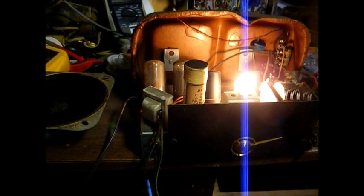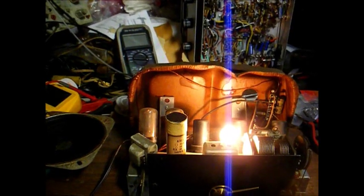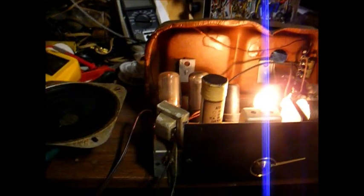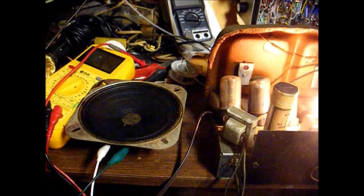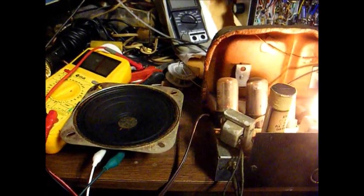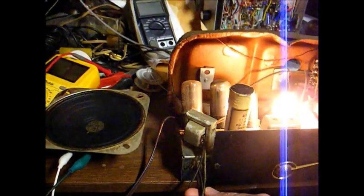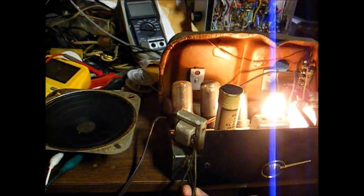The speaker's a little raspy. This radio seems to be working. We're almost ready to call it a day with this one. I replaced the AC power cord with a polarized cord, and I wired the power switch from its original neutral side of the power line into the hot side, which will make this chassis a little more safe. The speaker is eventually going to need to be replaced — I patched up a couple of rips in the cone, but the voice coil still drags, so it's a little raspy sounding. But I think that's pretty self-explanatory on how to replace a speaker.